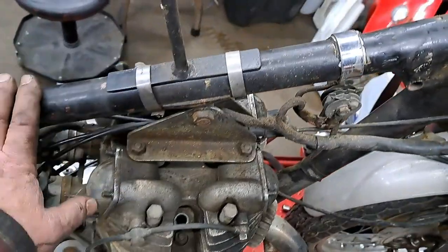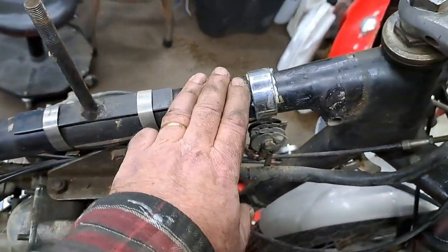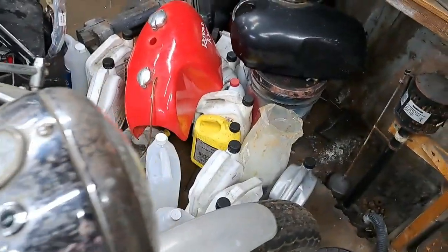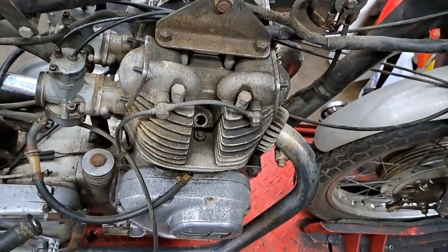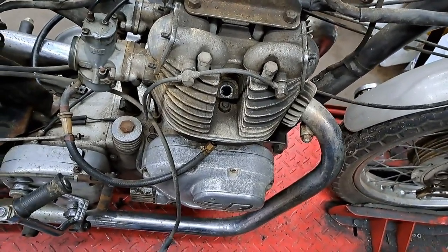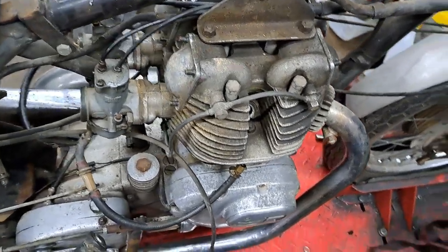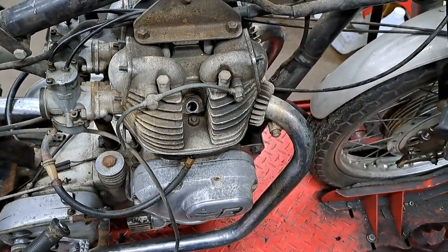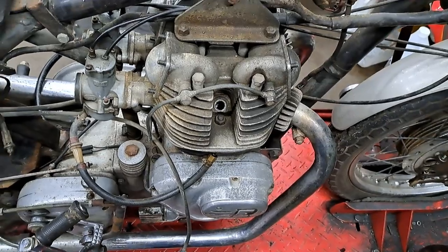And he had just 3-4 pieces of radiator hose on the frame to keep the tank from sitting right on the metal. So hey, that works, does the trick. Anyway, I took the spark plugs out after I kicked it over, and it really didn't have much compression. So it's got me wondering just what kind of shape that top end's in at all.